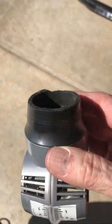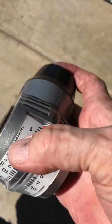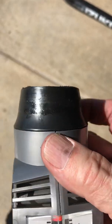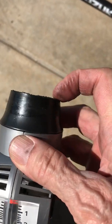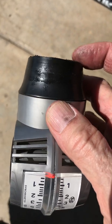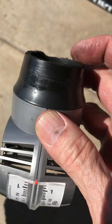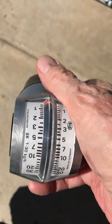You put the mouthpiece on your carburetor and the gas flows through it through all these big holes, and moves a little needle — say the orange needle. It tells you how much air is moving through there and you can sync your carburetors up. When you get this thing, you have to trim a couple of millimeters off the nose or it won't fit in your RG carburetors, because the thing projects so far and it hits the slide and you won't get a good seal around the edge. Just trim a little off — it's only a couple of millimeters. If you trim off too much, you have to go get another one. These things are about 20 bucks.